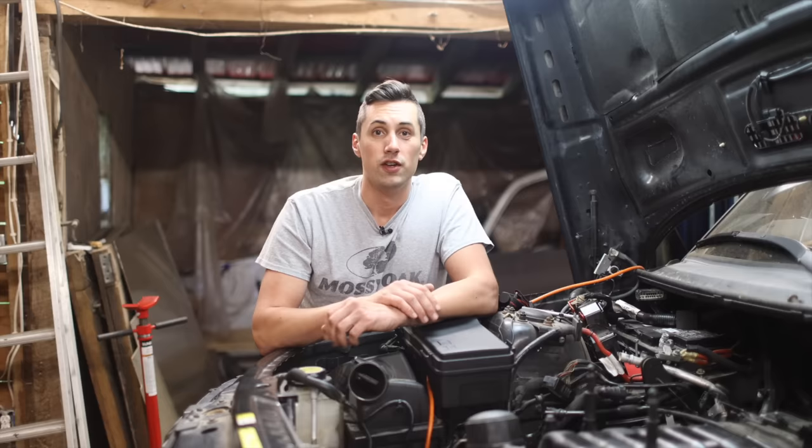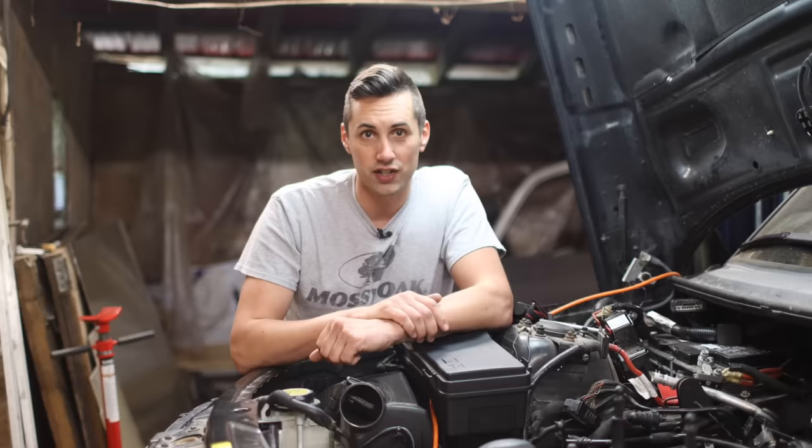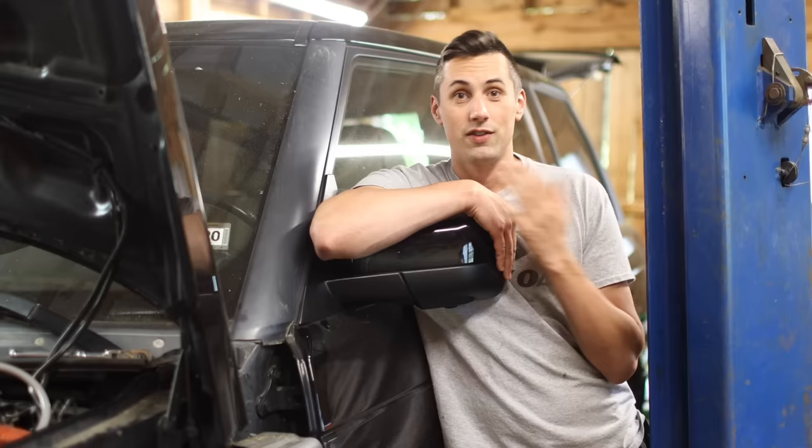As for pinpointing the leak, I can hear all of the air escaping from the crankcase, which means the rings are where the air is passing. I did a leak down test on all eight cylinders and they all had a leakage of five percent or less, which is excellent news. If there was any leaking from the head gasket itself, I would expect that to manifest as air leaking from the cooling system, which I should be able to hear — and I didn't detect any of that.